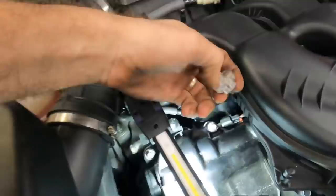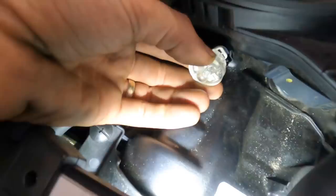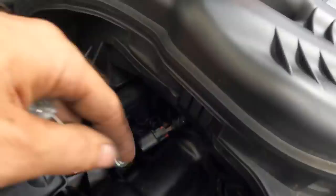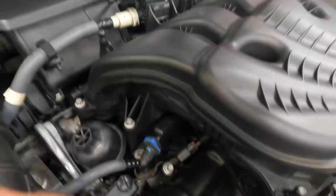Plug it in. See it? Yeah, it lights. Stand by. Now we can see it. See how it's flashing? That's the ECM commanding the solenoid in the injector to operate, but the injector is not responding. The ECM is seeing no voltage drop on the circuit, so it is hypothesizing that the circuit is open and setting that open code. Consequently, the engine has a misfire because the injector is not fueling that particular cylinder. So we have the secondary code, which is the cylinder number 2 misfire.